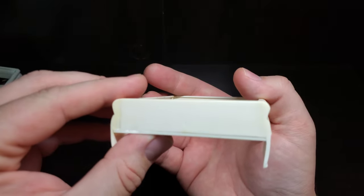With the bed rails it's all nice and smooth. Mine is all smoothed out really clean. I will sand these up with 1000 grit and get them ready for paint — I like 1000 grit, gives you a nice bite. I will be doing some masking so I don't want to get too fine and worry about pull-off. My broken hood still needs some more work; it may just end up with a bit of a lazy eye in the end. We also got a nice coat of primer on the dash, and I'll get these wet-sanded and then we'll see you with the color on.